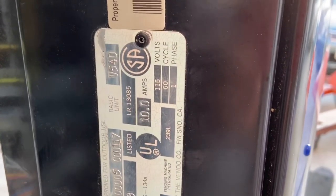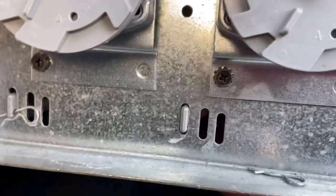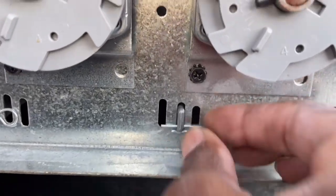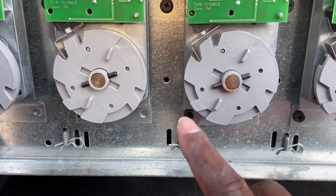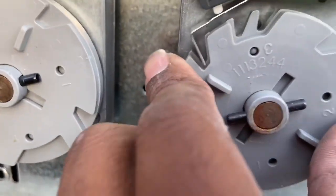This soda machine is a Vendo 540, by the way — says it right there. I'm gonna come under here and put it in the second slot right here. Bam. Put that back in. It's showing two, but I'm gonna put it on three because it's gonna be three deep — three cans going in. I turned it to three, as you can see right there. I popped it in three — that's for three deep. Put your drinks in and you're set, simple as that.